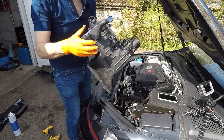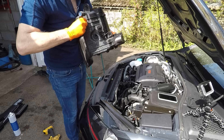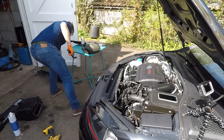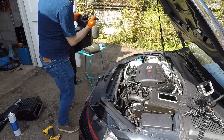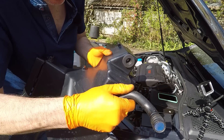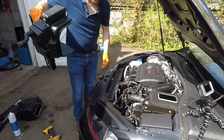Don't forget this pipe — it has a one-way valve in it that lets water out. If you get water in your airbox, it doesn't suck it in. Push the tabs and pull it off, then fit it to the bottom of the R600 in the same orientation — it points backwards. Give it a good shove; it's not the best fit, but it does get there in the end. Now it's a good time to clean in here, vacuum any leaves up, spray some wax — do what you need to do.